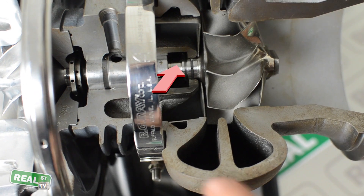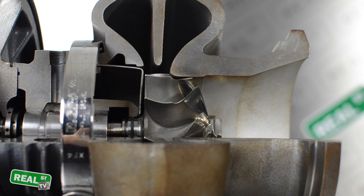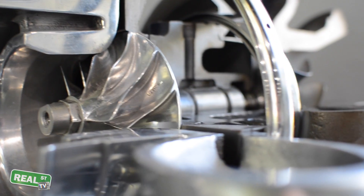and it's located by the bearing system of the turbocharger. As long as the bearing system is locating the shaft of the turbo, the seal doesn't leak. Before you jump to conclusions and think that your turbo seals are bad, there's a few things you need to look at: the oil feed, the oil drain, and the orientation of the turbocharger in relation to the running oil level of the engine.